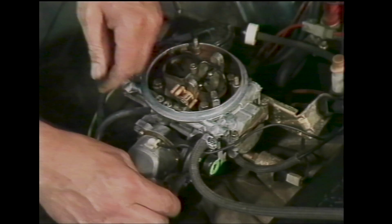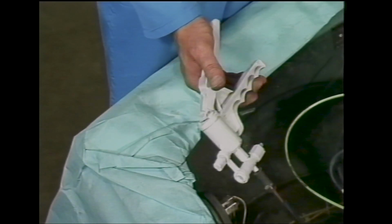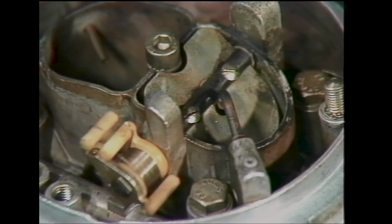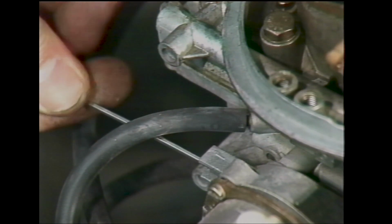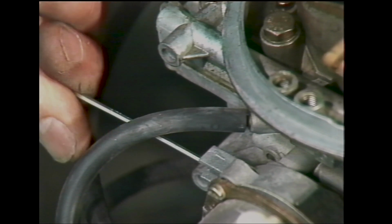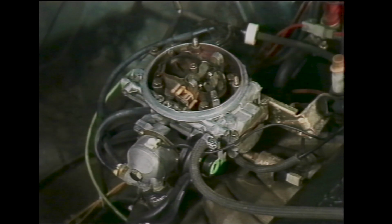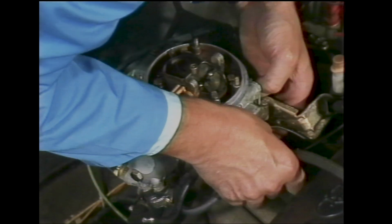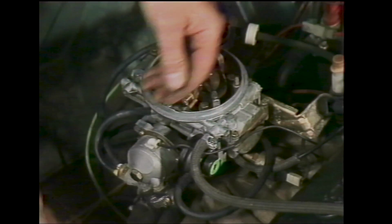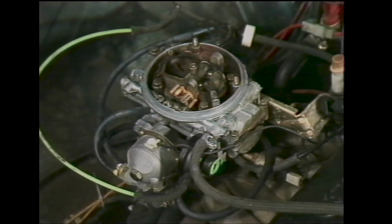6. Close off the outer connection of the pull-down unit. Operate VAG 1390 continuously. The choke valve should open to the second gap. Measure and adjust using a 2mm Allen key on the end of the pull-down unit's operating rod, both small and large units. 7. Remove VAG 1390 and replace the hoses. If a closely defined first and second stage movement is not obtained, or the choke valve keeps closing, replace the pull-down diaphragm unit.